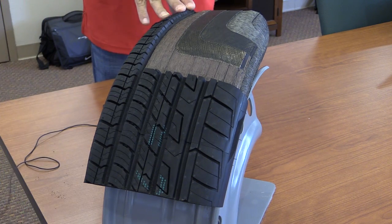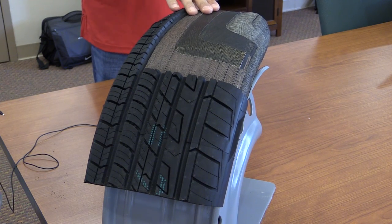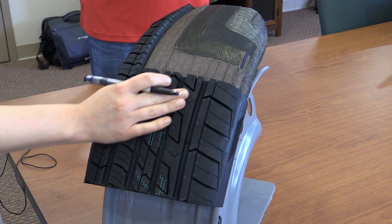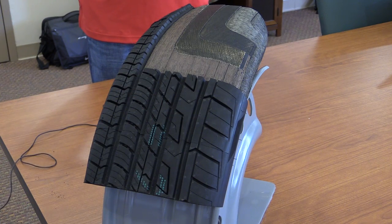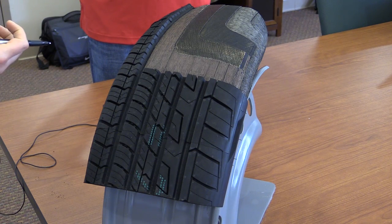Now, I understand there's a lot more silica in this tire than there was in the previous generation — what was the reason for that and what does it do versus the CS4? The silica — I believe we were at approximately four times more silica than what we had in the previous generation, the CS4 product. And that silica provides really good tread wear and helps provide really good wet traction for us in this tire.